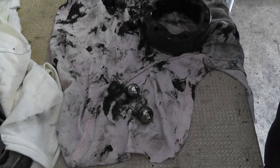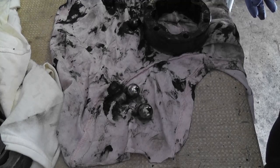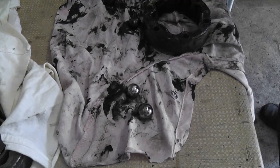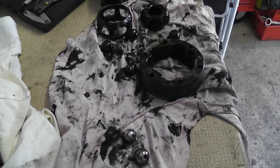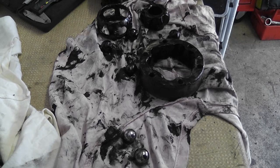So we're talking about 2.5mm difference in ball size, which is not insignificant. The question is why they put larger balls in — possibly to take the extra weight? But bearing in mind these CV joints were fitted to a van that had a 1.6 straight diesel engine — it wouldn't have had enough power to pull a soapy stick out of a dog's arse. The 1.6 turbo diesel did remedy the situation somewhat. The 1.9 TDI is grand — it's got plenty of pulling power for the task. I'm going to bag up that CV joint and do a more detailed inspection. Let's get the other shafts put together and put them in — I've already painted the shafts so they're all looking nice.